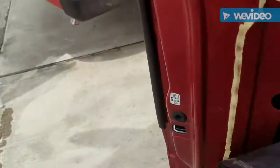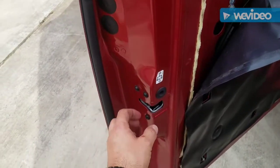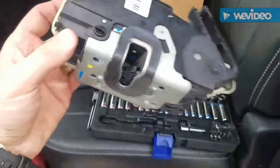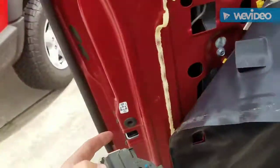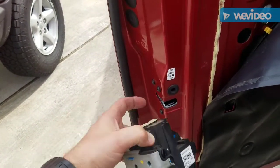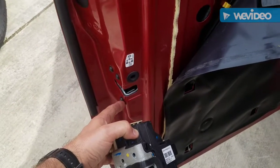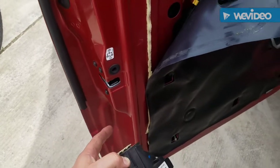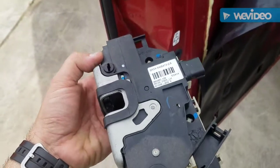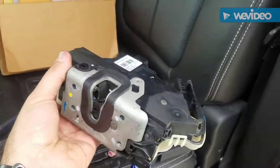That's what it's supposed to work like, but it only works that way if I keep these loose. That means there's some type of adjustment on here — this thing must not be exactly machined correctly, like the original Ford OEM one was. It does have a lifetime warranty, so what I might do is put some Loctite on it, barely screw it in, and see if it holds overnight. If not, I'll look at what an original Ford one costs — anything short of twice the price, I'll probably just bring this back and get a Ford one.